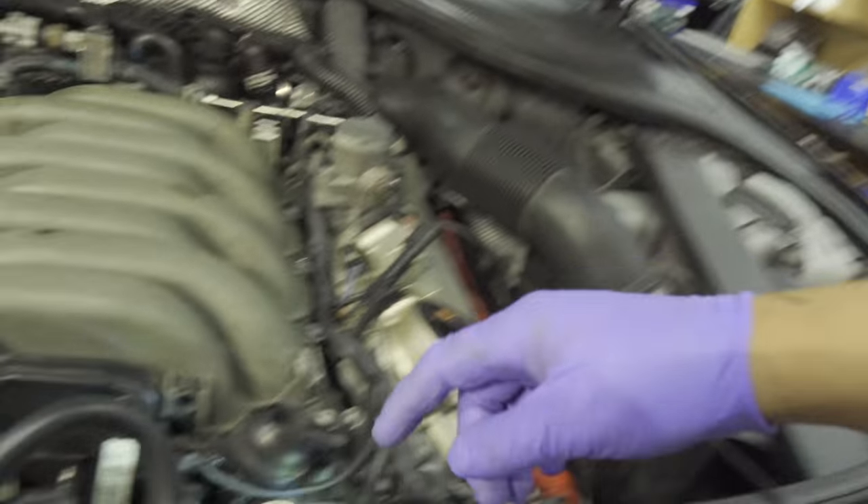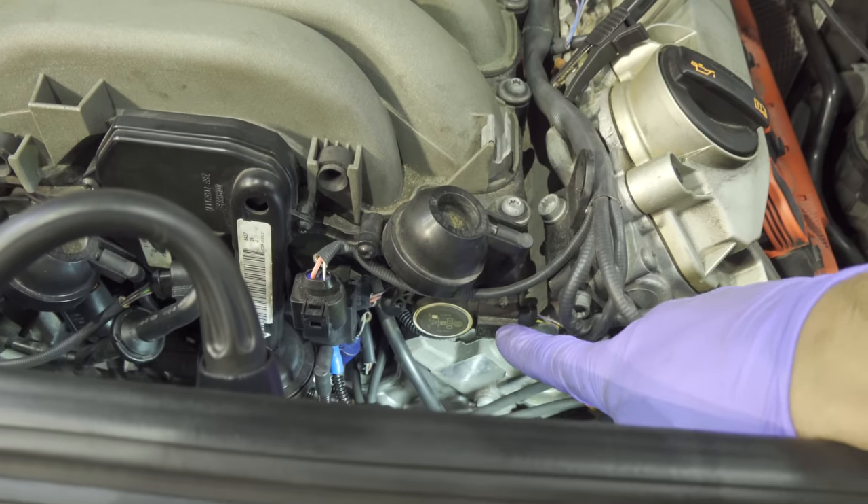It's going by the position of the runners, and the sensor is built directly on the runner. That's the position sensor right there — it's directly on the runner, and this is the diaphragm with the actuator on it. It literally sits right on it, so it doesn't make any sense to me. Those of you who still rely solely on test plans should get outside of that comfort zone and continue your diagnosis until you're 100% confident. We're not 100% on the diagnosis until we remove that valve and prove it is stuck open, so that's what we're going to do.